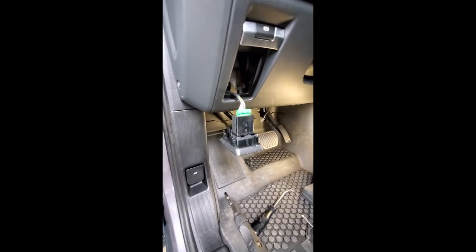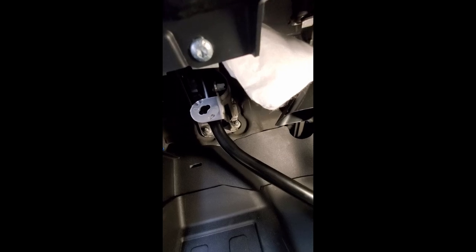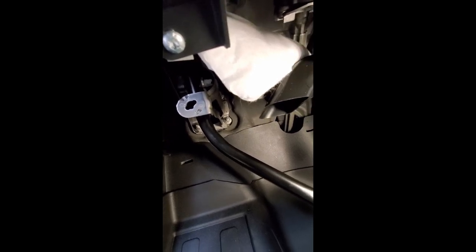The other thing you need is to plug it in up on the brake pedal. Here's the brake pedal — follow it along, and right up there is where your brake controller will need to plug in. I'm not going to pull the wires out and get them closer because it's a new vehicle and I'd like it to stay under warranty. But basically just travel up the brake pedal, follow it, and you'll find it. It's on the right-hand side.